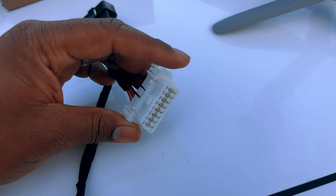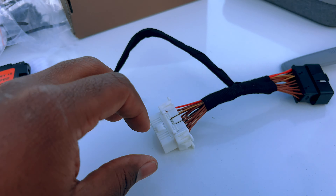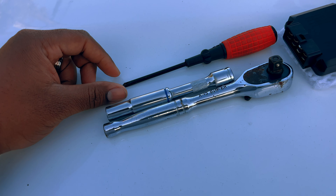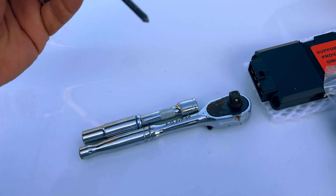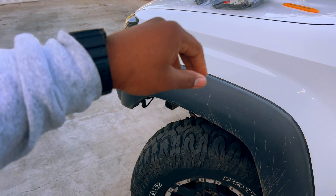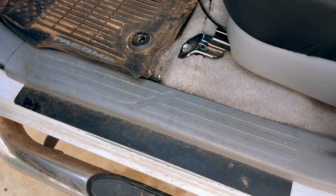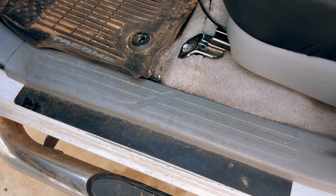For the 2011 to 2015 model you get two separate wiring harnesses: this first one is your ignition harness, and the second one is your OBD harness. You're going to replace your current OBD port with one side and plug the existing one into the other side. For tools required, it's just going to be a 10-millimeter socket or wrench and a Phillips head screwdriver, and we'll get right into the install.